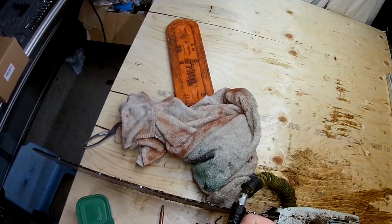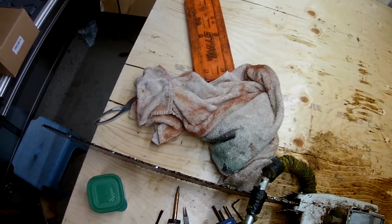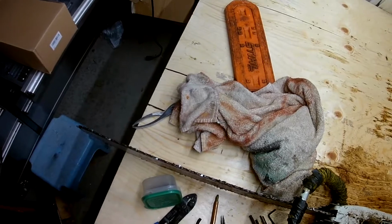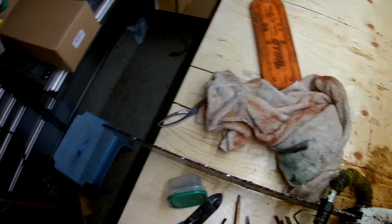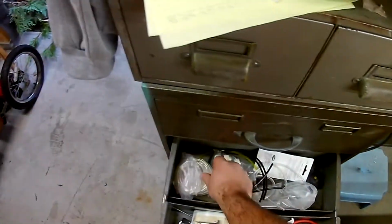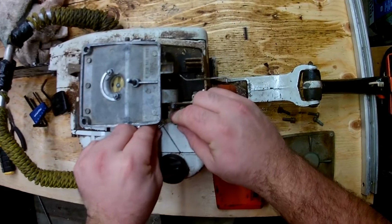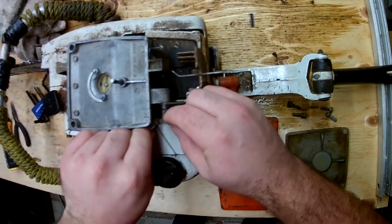Make sure to cut it to the right length, and ensure that the diameter, of course, is the same. Inside diameter is the major thing you got to watch out for, because if you get too much or too little fuel, it can cause some weird problems.